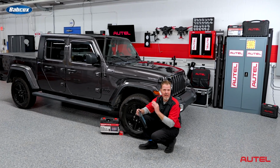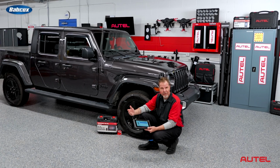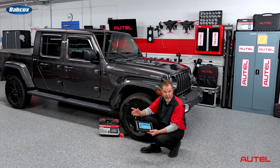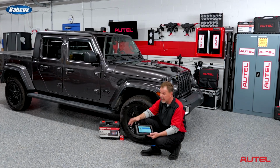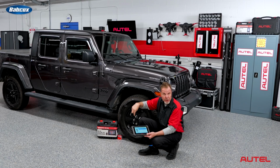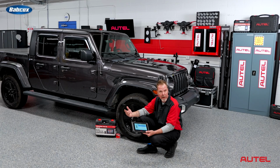Hey, here's a tech tip that is getting way overlooked in the industry by a lot of professionals, and that has to do with when you're replacing 4 tires. You might not think that's a big deal at the time. However, I will suggest if that car is anywhere between 7 to 9 years old, you better watch out. It is a good idea to test before you touch. Test all 4 of those TPMS sensors to make sure that they're okay.